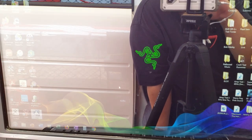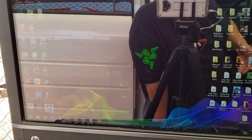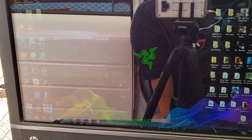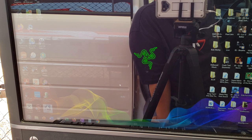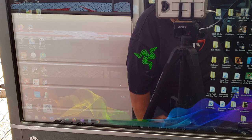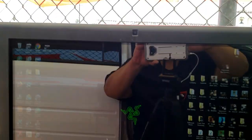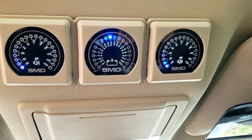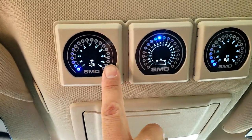Now let me start the distortion tuning on the amplifiers. You need to have your frequencies set up before you start your gain setup. Volume 21 was detected as distortion, volume 20 was clean — so I'll stick with volume 20 as my clean reference. For the subwoofer at 40 Hertz, volume 21 should give distortion and volume 20 should give a clean signal. You can see the output meters are already on but not yet tuned.